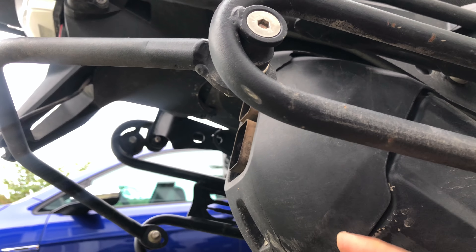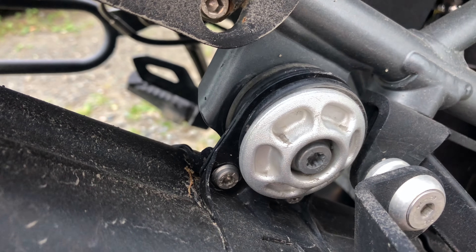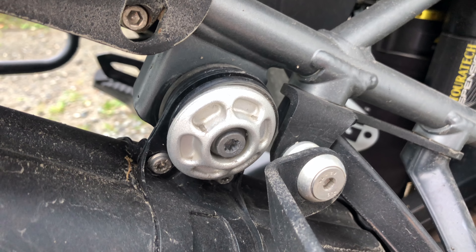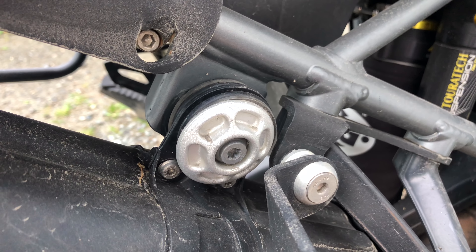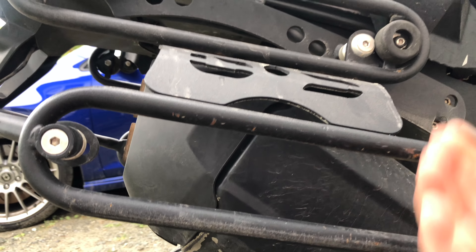This plastic shroud piece broke, and this part here is also dented. The silencer is going to need replacing. You can see how this line shows how much the silencer moved, which led me to think I should check the bolt up top that bolts into the frame. You can see how this is off-kilter from where it should be — it's to the left. The bolt may have been bent, or it could be that piece that's welded into the frame. This Jesse rack is pushed upwards much higher than it was before.